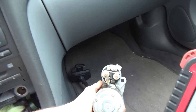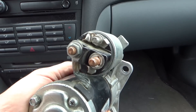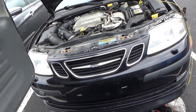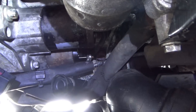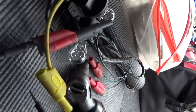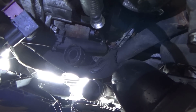We need to get to the starter and check for a good feed on the main positive. That braided cable could have corroded through, but we have a known good starter — at least I think so. Let's dive under the car. First step: get the air pump out of the way. That clears up room around the starter. Now with the test light — battery yellow and black lead — let's make sure we have power on the main starter post. Nothing. That's a problem.